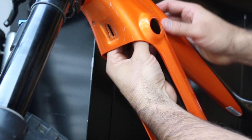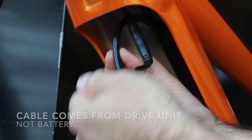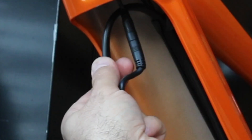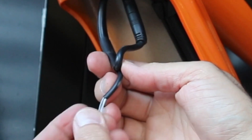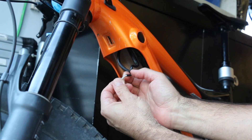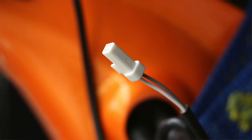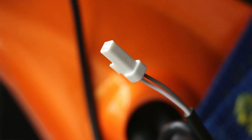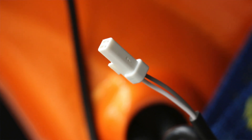When you look up here, we've got this big cable from the battery. This is the key to the switches — the handlebar controls — that can come off. And then this here is the lighting connector. From all the research I found, this is a 6-volt connection, and sure enough when I measured it, it's 6 volts. Grey is earth and white is positive. The unit comes with a silicon cover over this white connector. If I can find the details for this connector I'll do my best to put it up, and that way if you can find the opposite parts you don't have to do any cutting or clipping of cables.